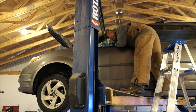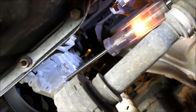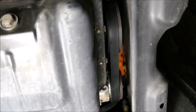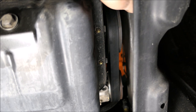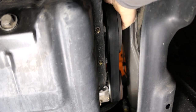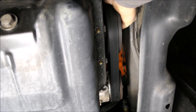I'm going to try and start it a few times. If you are concerned about your engine being locked up or you don't know anything about it — somebody else's vehicle — just turn this pulley right here and make sure everything's free. On this little car, you can just do it by hand. See there, the engine's turning so she ain't locked up, which I already knew that.